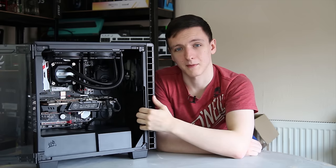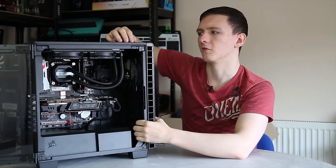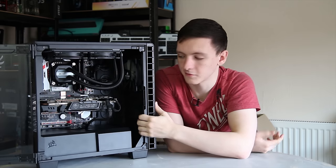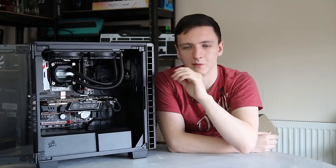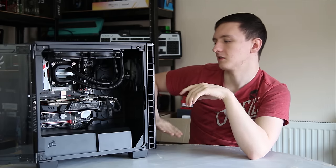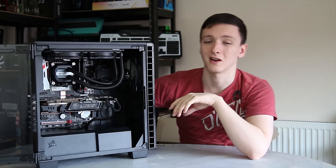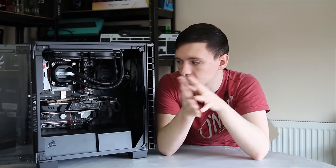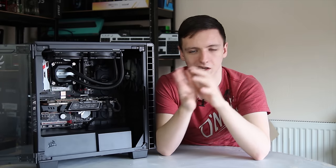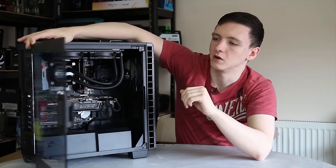The Kingston Savage RAM is actually quite low profile so it's not too much of an issue, but if you have something like the new Vengeance LED RAM, which sits quite tall, you won't be able to install the cooler at the top and will have to install it at the front instead. That's not too much of a problem because there is a magnetic dust filter at the front which is actually a bit nicer than the magnetic one at the top — the top one is more for aesthetics than function. I personally recommend putting the AIO at the front. There's no 5.25-inch bay, which if you're building a VR system means you'll have to plug all connections in at the back, but for most people that's not an issue.